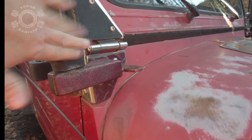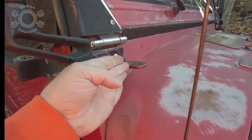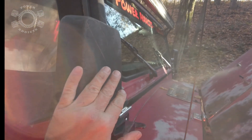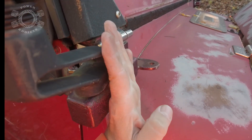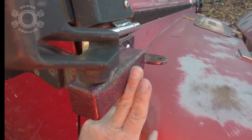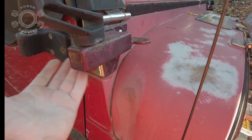My mirrors stay put even if I take the doors off. If you want to copy this idea, the bar needs to be perpendicular to the ground — I welded it flat to the plate, which doesn't allow enough mirror adjustment. The driver's side mirror is almost useless. The fix is to tilt the bar outward so it's perpendicular to the ground — put your level on it, tack it in place, then burn your welds. The tubing is one to one-and-a-quarter inch square, about eighth-inch wall, so it's not very heavy.